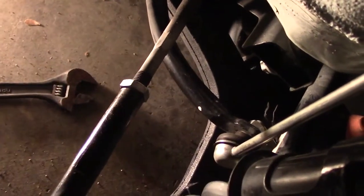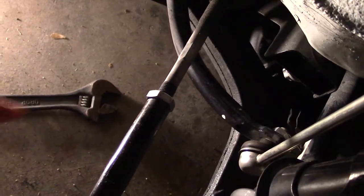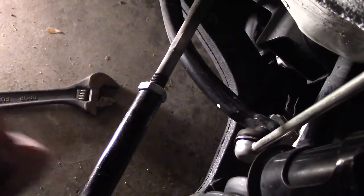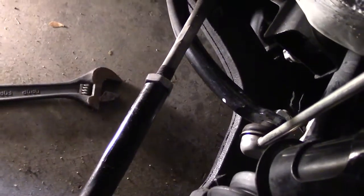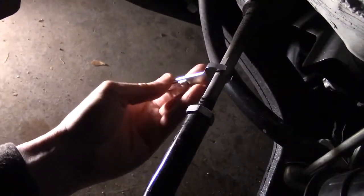I've put a little ink mark on the top of the tie rod end so we can track what we're doing. Since it's toe out — the fronts are pointed outward — and this adjuster is located at the back of the wheel, we're going to want to extend it outward. I'll do four revolutions, then go to the other side and do four revolutions. Without tightening the lock nut we can spin the wheel again, take another measurement, then finally tighten the lock nut to secure it. For now I'll just turn this one full turn to the left to push it away from the tie rod end.